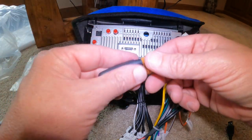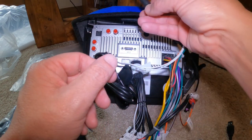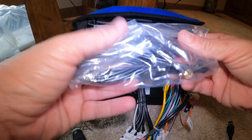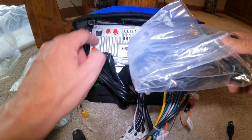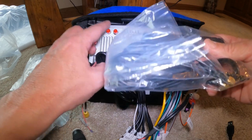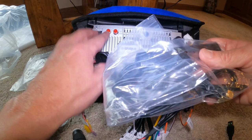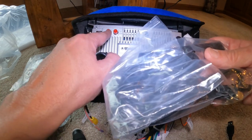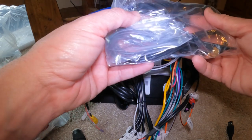You're also going to have this little antenna — this is for WiFi or Bluetooth, and it goes right here. Then you're going to have a stick antenna — this is your 4G antenna. There's one marked 4G minus and 4G plus. More than likely it's going to go in the 4G plus. If there's any difference, I'll clarify in the instructions. You can mount this anywhere inside the dash or inside your glove compartment.